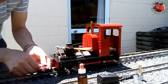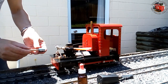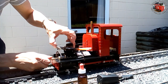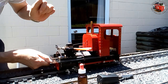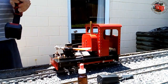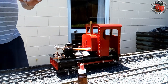Removing the coupler assembly. That's the starter shaft — I've got a silicone tube on the end so I can grip it to turn over the motor. I'm just sucking up some fuel there, just to fill up the tube — there it goes — but not to draw any excess into the engine. That's where all my flooding problems were before.